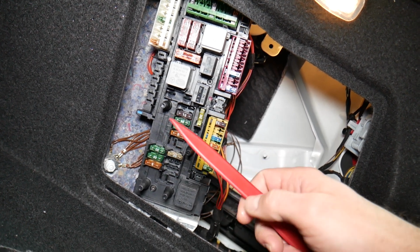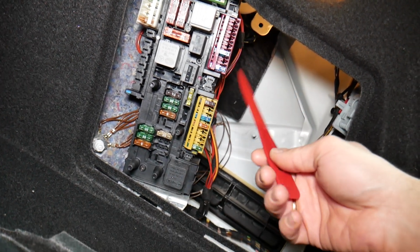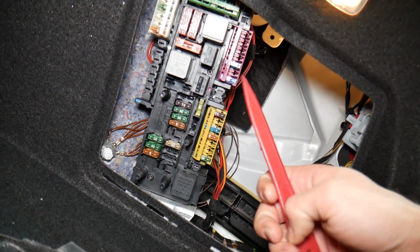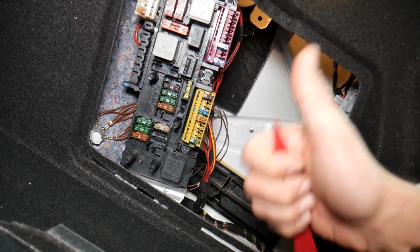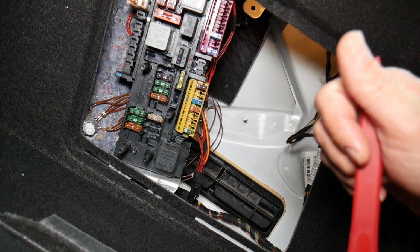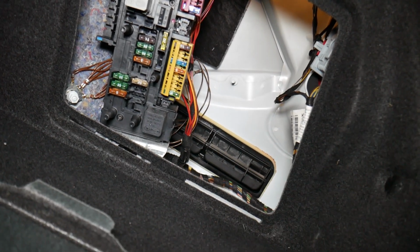Now, what about relays? You don't have specifically dedicated relays, but the front and the rear SAM control module is what does the relay function. So if you have problems with the door modules, check fuses and relays for front and rear SAM module. That's the SAM module. We'll have the videos on our channel if you need help with that.